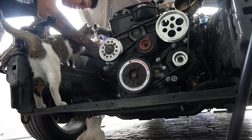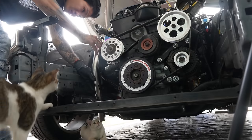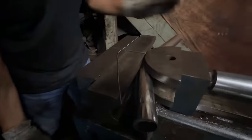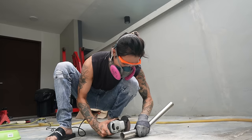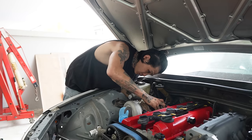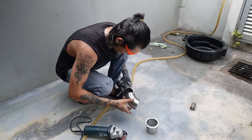Then I worked on my dump pipe for my wastegate. I got that pipe bent at the exhaust shop so I didn't need to do so many welds on the pipe. And that is my wastegate dump pipe. At this moment I reverted to my previous first design — removed all the tack welds and redesigned the whole thing.